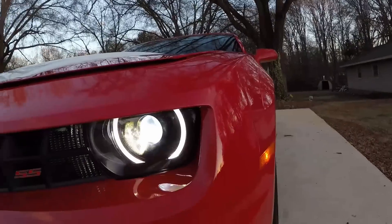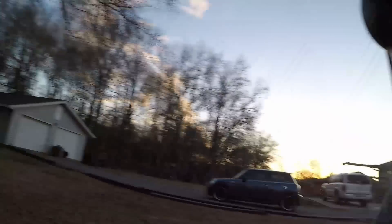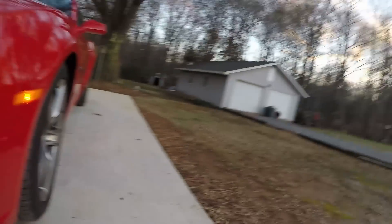Continuing on the lighting aspect, mod number two or three — some people put lighting in the footwells, but this one is more of a safety thing. Any of you that have these cars know the daytime running lights go off with the headlights. Mine has the RS package with halo LED lights, and the fog lights didn't match — they were halogen and yellow. So I replaced the bulbs with LEDs and added a wiring harness between the existing harness and the back of the LED bulb on the passenger side daytime running light, which makes the DRLs stay on with your headlights like a fog light.